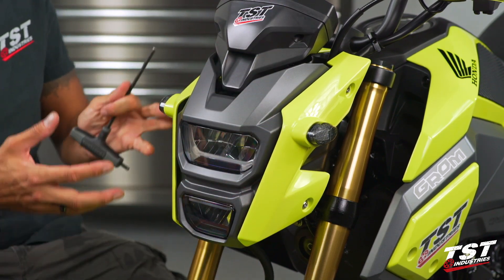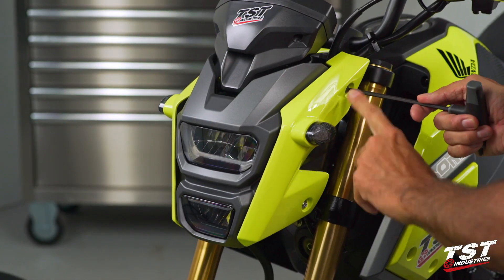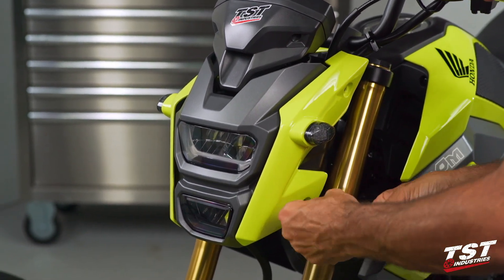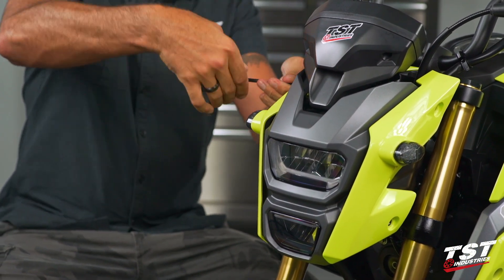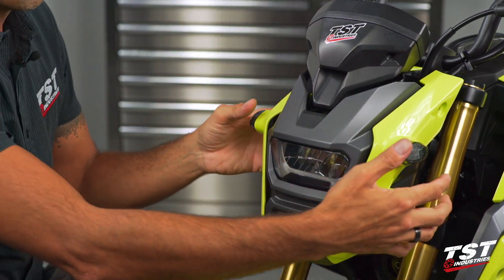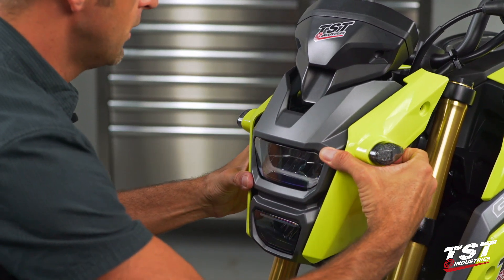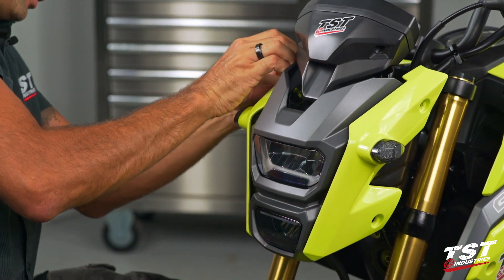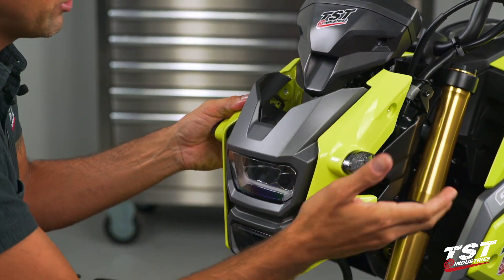This entire component is one piece. We will use a five millimeter Allen to remove these two fasteners on this side and two in the same locations on the opposite side. Once these fasteners are out, we'll just grab the painted parts and spread them apart from the center line of the bike. That will clear the holes from the bosses that capture the geometry in place — they do have shoulders, so they do need to be spread apart.